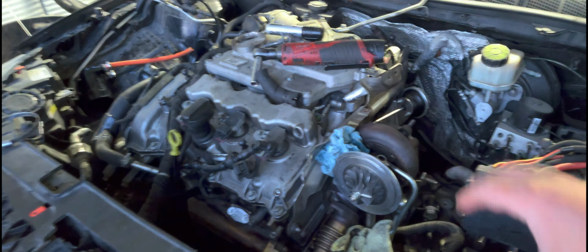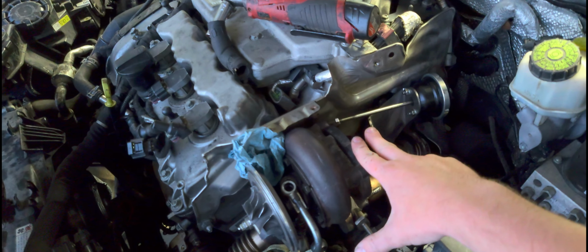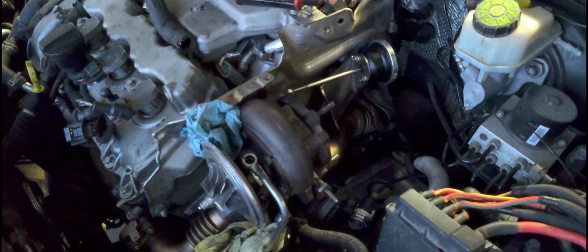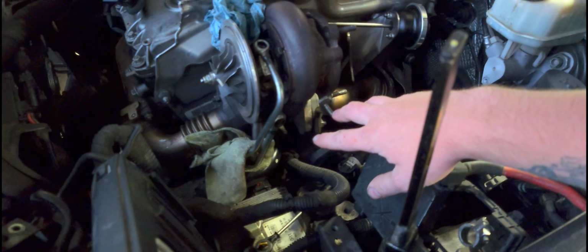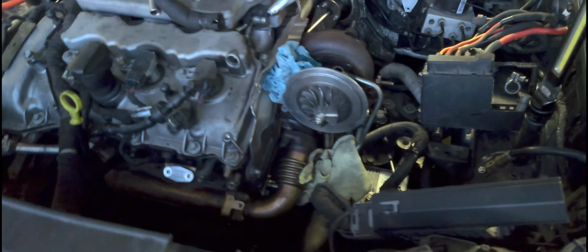So this is a Garrett GT3076 turbo with a smart wastegate. This is actually built by Genuine Saab. Not the turbo itself, but the adapters to make everything fit. So this is an adapter to bolt to the factory downpipe, as well as the adapter to attach to the factory up pipes. It is larger than a stock turbo, but you could actually probably machine a stock turbo like I sell and honestly get about the same gains.